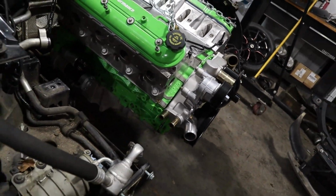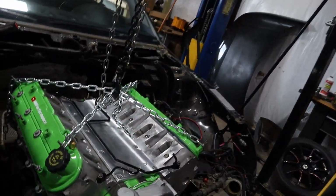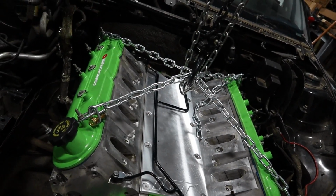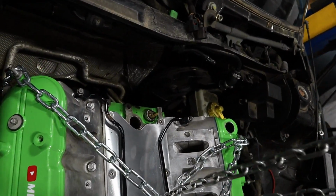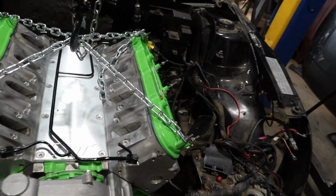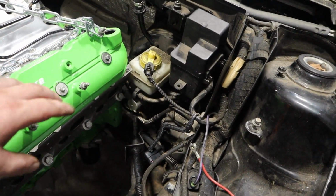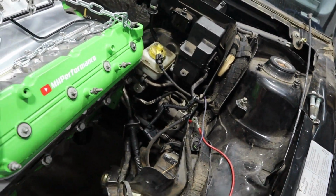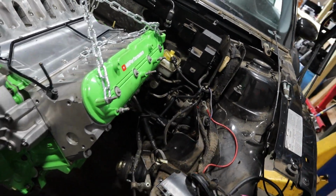So it should clear, hood should close, but I maybe have to turn around the air intake if that's possible to get the air intake up there. And then to the side, we maybe cut this off. Definitely have to cut in the firewall. I would like to have it more back, but the brake booster is in the way. Yeah, the whole brake system is in the way, and I cannot really relocate that. But yeah, it should fit like that.